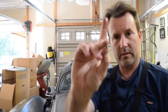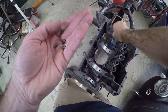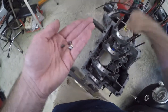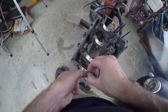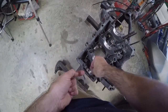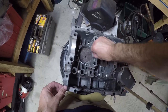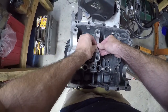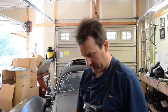The first thing we're going to do is put these dowel pins — I showed you in a previous video — back in the engine case, or actually the case halves. Sometimes these fit a little tighter from one hole to the next, so I'm going to find the ones I'll be happy with. Now that we've got those in, it's time to do a little fitting with these bearings.